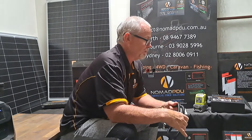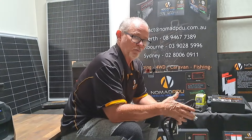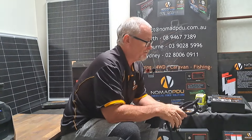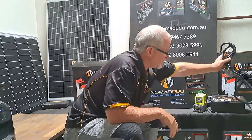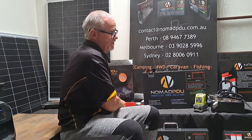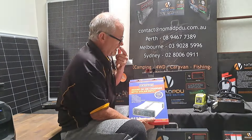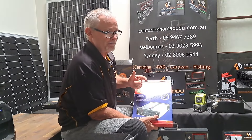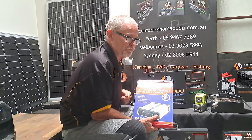Now we're going to talk about the full dual installation where you've got a hardwired solution. We're going to be doing that today — in 47 degrees of heat in the van we've been fitting out — and that's going to be with a 40 amp DC-DC. This is the other end of the spectrum, running a heavy duty unit. This has been provided to us by Batteries WA, which is a Triton product by Mattson, and this is the 40 amp option. It does have a solar input.